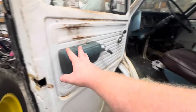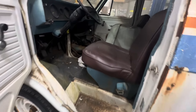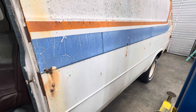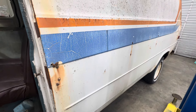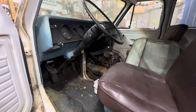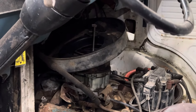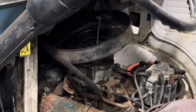I went and picked this van up today and was going to unload it off the trailer — the ignition module was bad. I stopped and put twenty dollars worth of gas in the tank, which I never do. I just wanted to get the van up and running to move it around my property. I put some fuel filters in the line, maybe two. I rebuilt that carburetor some time back — the breather is just kind of laying on there, and that rod coming up out of the carburetor, I can't get the bottom off so it's just flopped around.